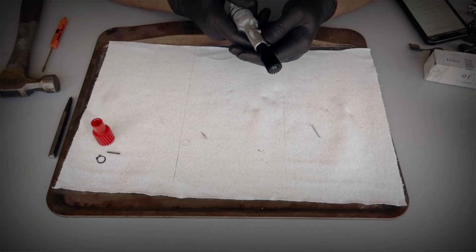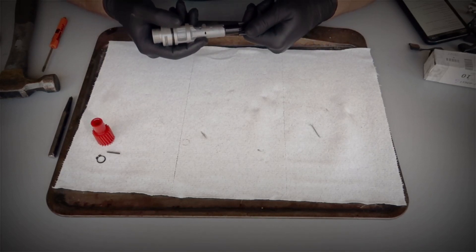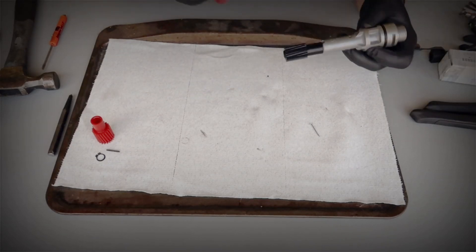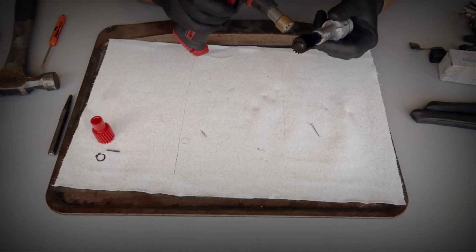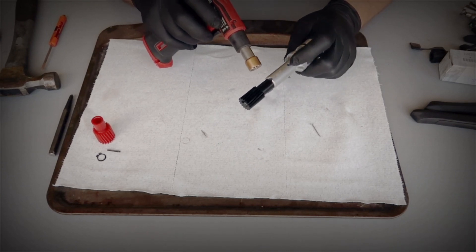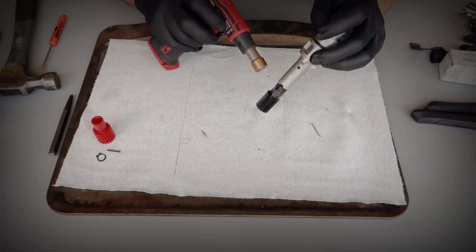The first thing we need to do with this new speed sensor — we're gonna be utilizing the body from it — is figure out a way to get this black toothed wheel off. You can cut it off but you don't want to scar the shaft too much, so the best way I've found is to just melt it off. The plastic really isn't that strong and it melts right off with relative heat. This is just a little snap-on butane torch — you can use map gas or most anything.